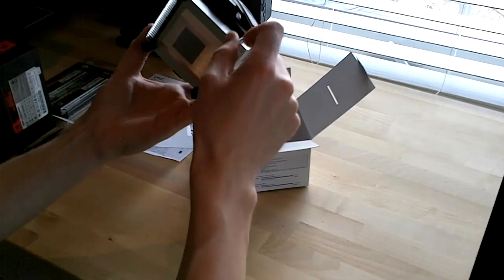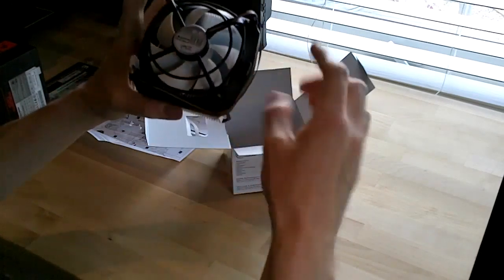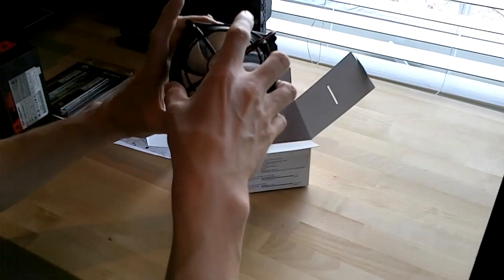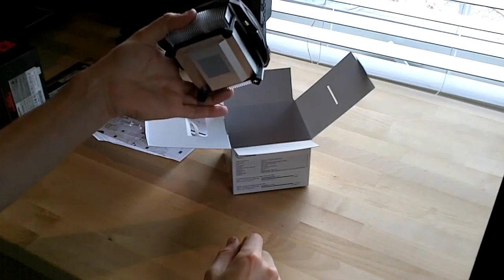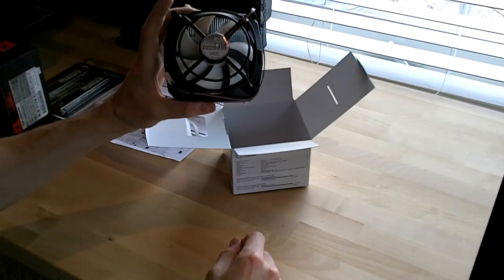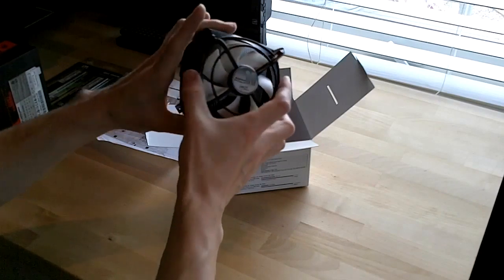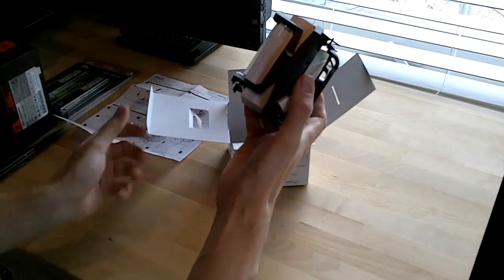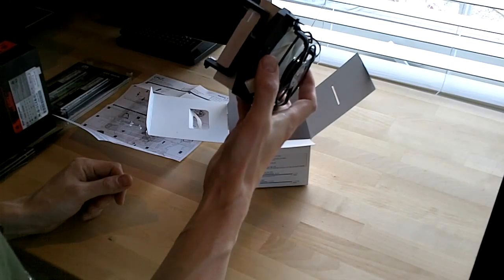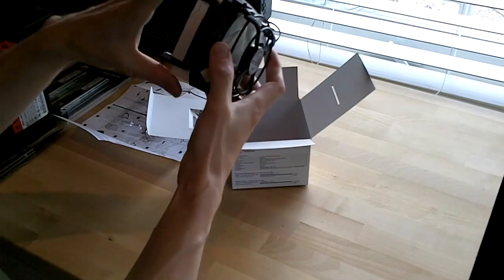I believe you just attach this black bracket using the clips to the motherboard first, and then screw down the CPU heatsink with the little screws on the side, and that holds the whole unit down to the motherboard and CPU. So we'll have to see how that fits on my Gigabyte Mini ITX board. Hopefully it doesn't run into any problems with clearance with regards to the RAM and any parts on the motherboard. So we'll post some videos of everything going together a little later. All right, see you later.